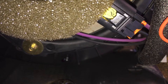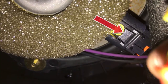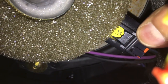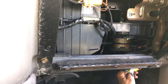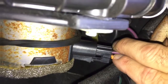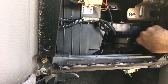There's the bottom of it and you can see that little clip right there. You can see that little black knob — that's what's locking right on that edge, so that's what we're going to have to push up to slide it out. I'm going to take the needle nose pliers, push that little tab up, and while I'm doing that give it a good pull — and there we are.